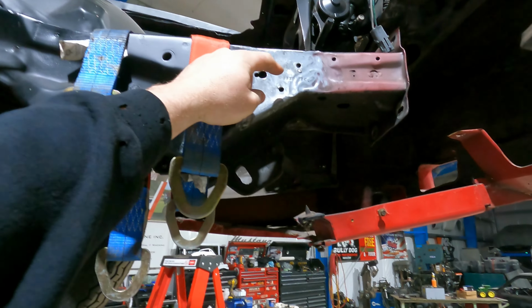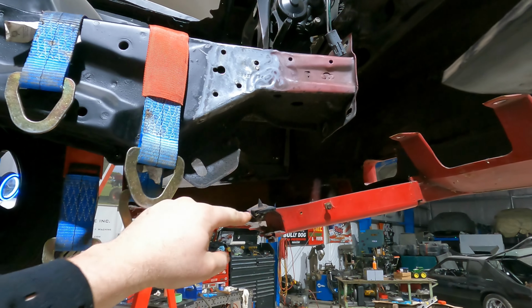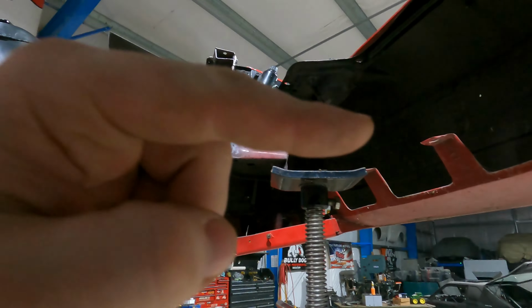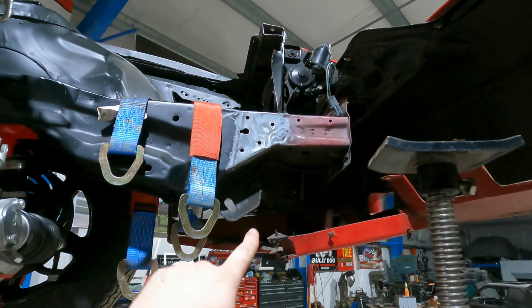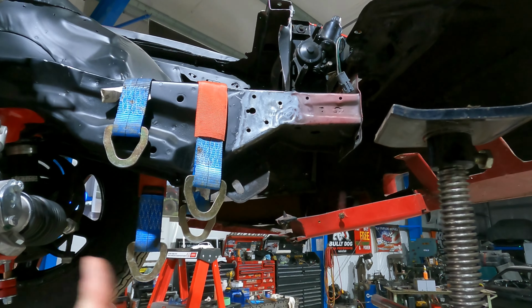a 1¼-inch tube, which is what we use on the torque arm. We're gonna come down like this. We're gonna come over, all the way over to this frame rail and back up. And then off of that, we're gonna do a little halo in the front, a little halo in the back, and the rad will hang behind it. The intercooler will hang in front of that 1¼-inch main hoop there. And then we're going to go from this point here down to the front, around here, back up this guy, and over back to this side, all out of 3/4.